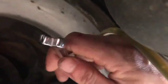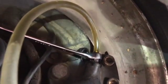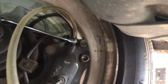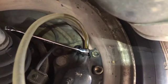And that power bleeder is putting the pressure on so that all this is working. All right, and then once you're done, righty-tighty, tighten it up again, and we'll move on to the next. So no bubbles, which is good when I didn't think we needed it. But we're going to hit each corner anyway, and then the clutch definitely does need it, so we're going to see some bubbles on the clutch.